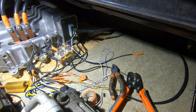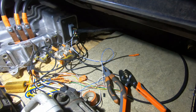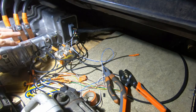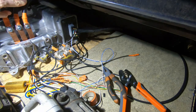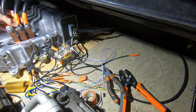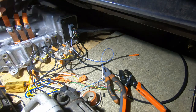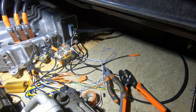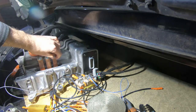Okay, that's everything pretty much wired up. Now we just need to install some batteries, link them together, and then connect the battery plus and minus side. Before we do that, obviously we'll run some tests to make sure power is going to each of the relays as expected. The one other thing I want to do while I've got access is take these wires off and put some shielding mesh on them — to prevent interference. A couple of people pointed out I might as well just get it done rather than waiting. So I'm going to get these wrapped in shielding mesh and then wrap them in orange tape so they're fully ready and compliant.